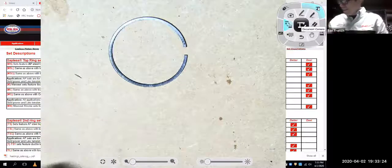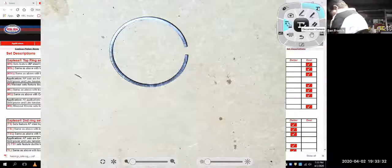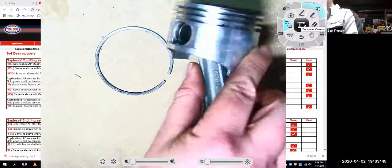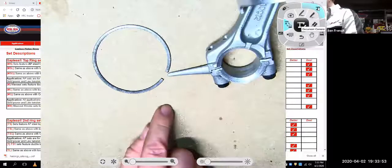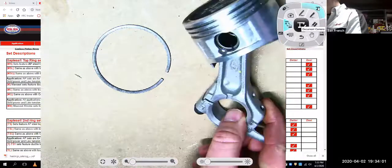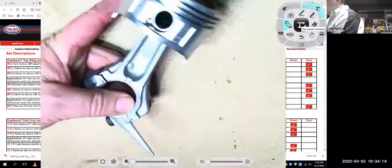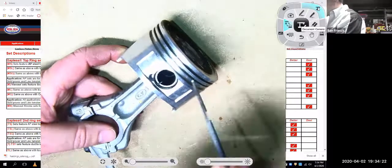Is it like a jeweler's stone? It is like a jeweler's stone but because it's spinning at a bunch of RPM - it's set up with a dial indicator, all real precise - people just think they're grinding a piece of angle iron or something. So a hand file, if you're real careful, will work just fine to adjust that ring gap. Now for putting the rings on - I said I didn't like using the ring expander tool.